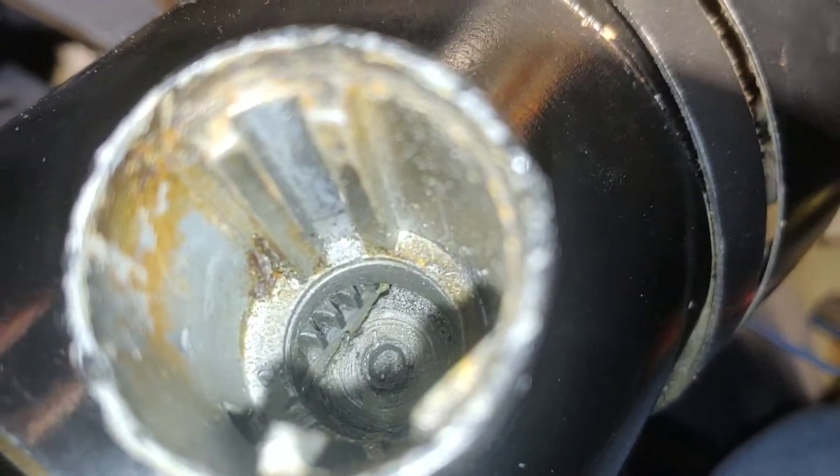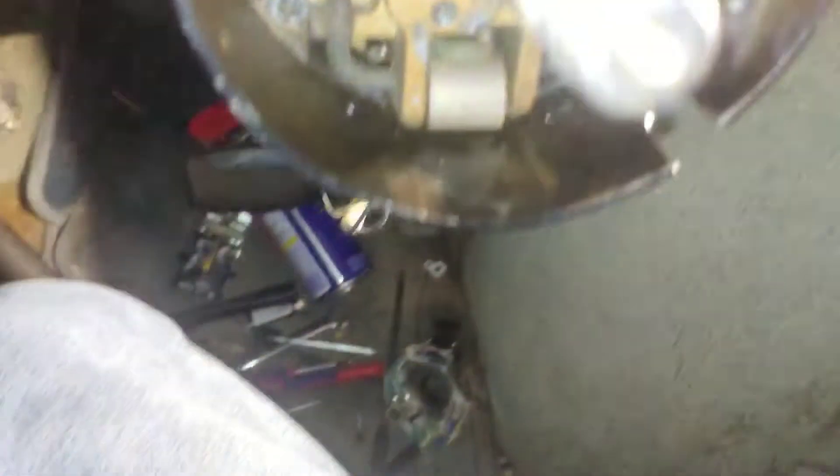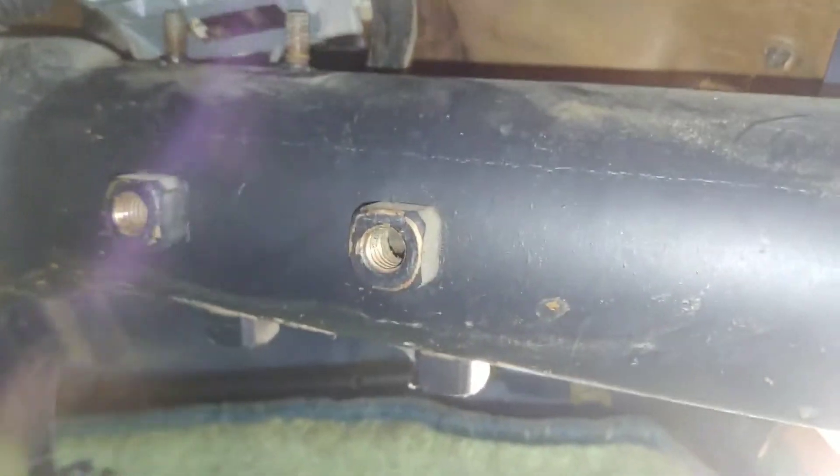See that little gear up in there? I take the tumbler and the washer that goes to the tumbler — I call it a washer, not really a washer at all — I take that out so I can get all this timed. This washer and this gear, see, get them timed to the ignition switch that's connected to this rod right here. See it down in there.